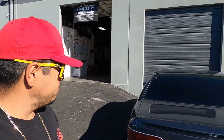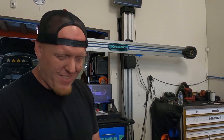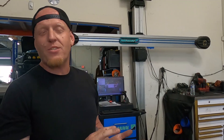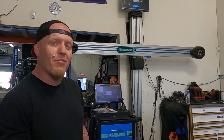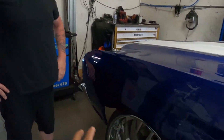We're going to talk to Mike about what's involved, what the process is, and how to go about it. Mike tells us: we're going to get this 1970 Chevelle all aligned, fix some pinion angle, and make sure caster, camber, and toe are all set — get this thing driving so you can fall asleep driving it.